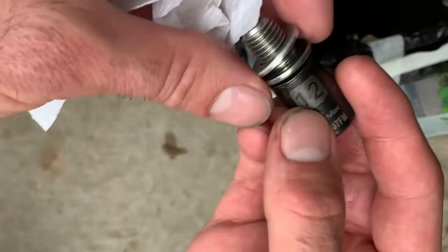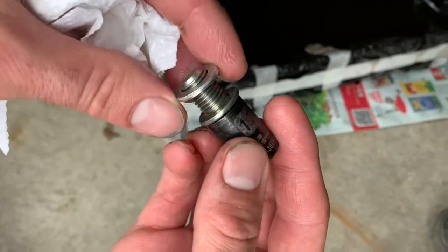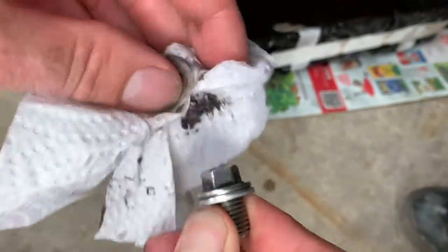Put our new washer on. Although reusing the drain plug seal washer is not unheard of, it's good practice to replace it at every oil change. If not, just be sure to carefully monitor after sealing to ensure there aren't any leaks. I'll drop a link below for anything you might need on Honda's website in terms of replacement parts.